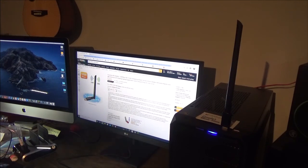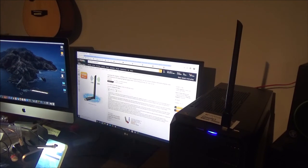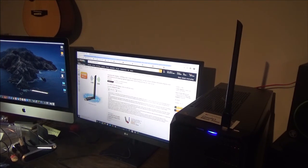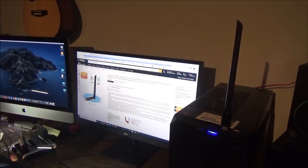It works as it's supposed to, and the faster the internet package you have, the more speed this thing is going to be able to give you, up to the 1200 megabits per second, they say there. But like I said, who do you believe? That, or do you believe the card? The card is only saying 867. One guy on here, I don't know what he's got for a connection, but he's pulling off over 700 megabits per second with this exact same unit. So that's pretty much on par with that 867, and it's an up too, right? I tend to believe this more than that 1200 part, but it's hard to say. You might find a connection out there that can actually pull it off at full horsepower at that kind of speed, which is absolutely insane.